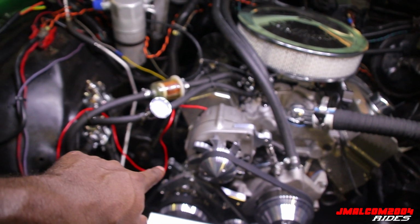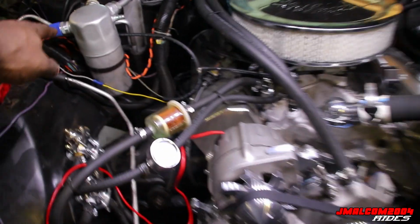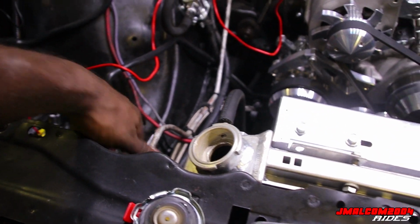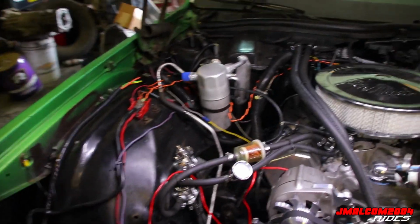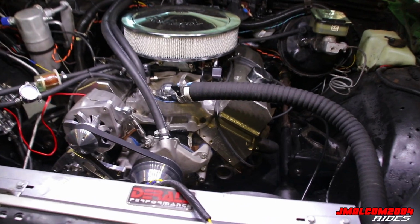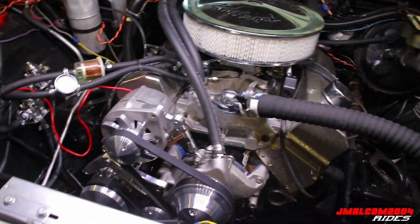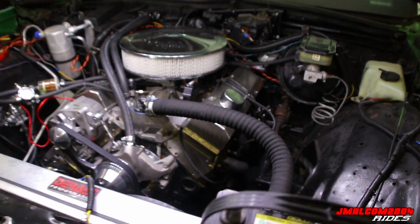It's an eight male fitting, and I think there's an 8 up there at the dryer too. So you run off the dryer to this side right here, then off of there and run it to your condenser. So yep, they're coming next. Then we're gonna charge it up and all that. AC wires, all this stuff still in the car. So let me get the battery put back in here. Antifreeze in here. Then we're gonna fire it back up, so stay tuned.